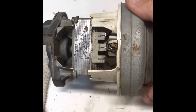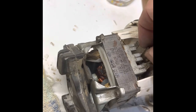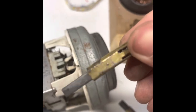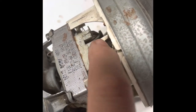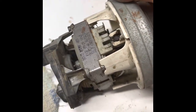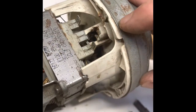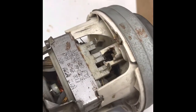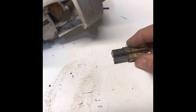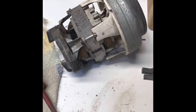Even the one on the other side doesn't look too great at all. I'll take that out as well — you can see how simply they come out. Same thing: clean it right up and get a much better contact. I'll clean up the top of both of them, clean up the two tabs, bend them down slightly more, put a bit of contact cleaner on it. They're not even held in very well at all — I sort of thought it looked like something had snapped off, but it hasn't. They just wedge themselves in place. So I'm going to quickly clean them up and then probably just put some epoxy or something to hold them in place to stop them moving even further. There's loads of life left in those brushes — plenty of carbon left — and hopefully that's all it is. I'm pretty sure it is because it looks quite obvious.